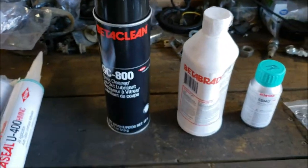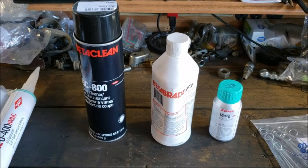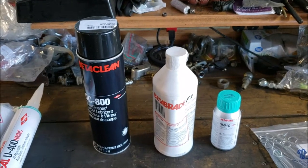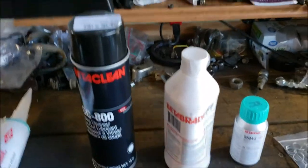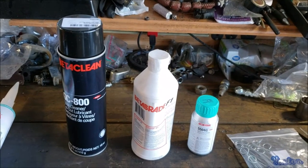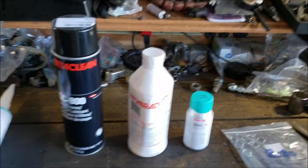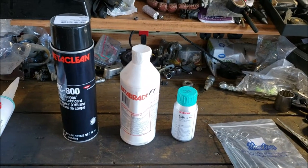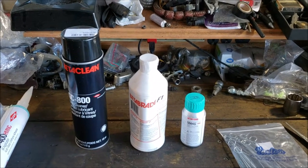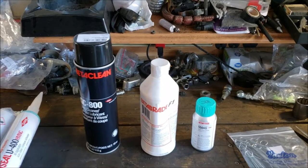Now, we're going to have to prep for that urethane, okay? I guess you could go the cheap route, buy an $8 tube, primerless, use a little Windex and you're good to go, okay? Well, you're going to worry because you got your other additives, especially Windex with ammonia. You don't want that. There's so many different additives that can leave a residue behind. Even a lot of residue cleaners leave a residue behind. And this is glass.